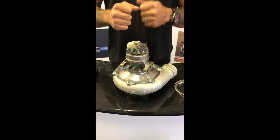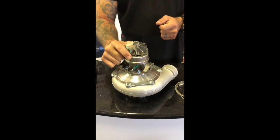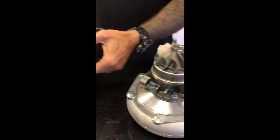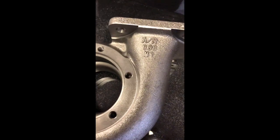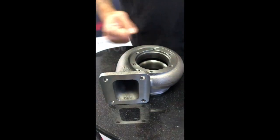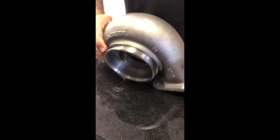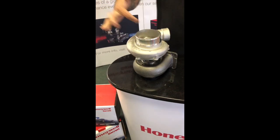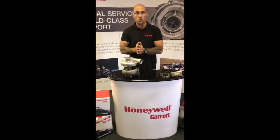For those of you that know the part numbers, it has a 1.32mm oil gallery that feeds the journal bearings. T4 stage 3, otherwise known as your 74mm inducer and 64mm exducer turbine, coupled together with an AR-0.96 turbine housing, T4 inlet undivided with your V-band outlet. This turbocharger basically provides you with a 950 horsepower capable setup, and it is journal bearing.